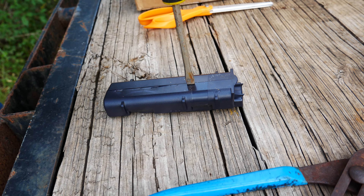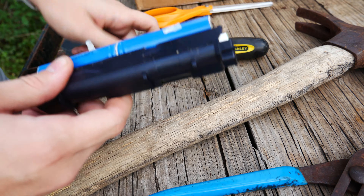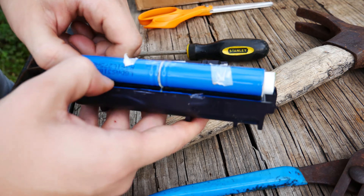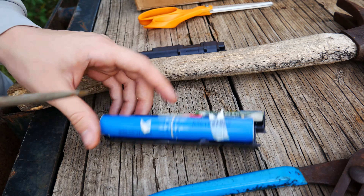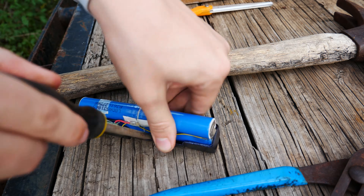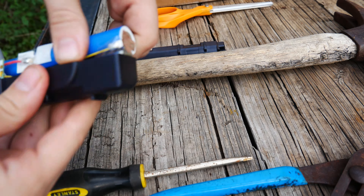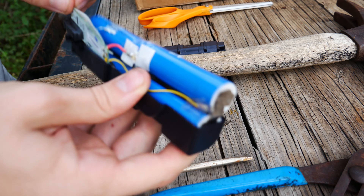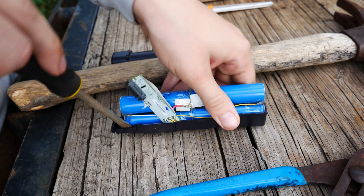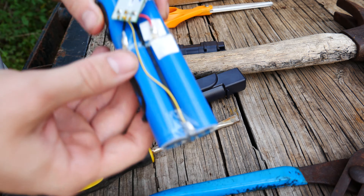Really easy to do. If you notice it's sort of split apart with that last hit — when that happens, I usually just pull apart the casing with my hands. It usually comes free pretty easily. Now usually these batteries end up being glued into the casing, and this is the part you want to be very careful with. I just lightly pry with my screwdriver and slowly work the battery, moving positions as it starts to come up. You'll definitely know when it's ready — it usually just pops out like that.